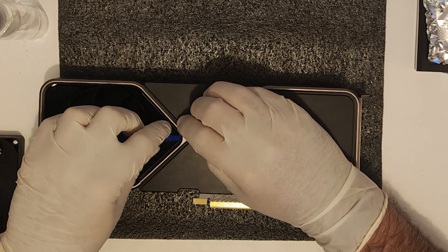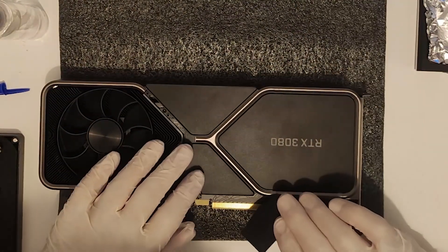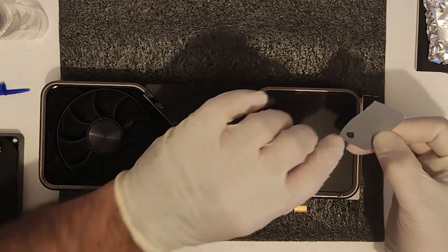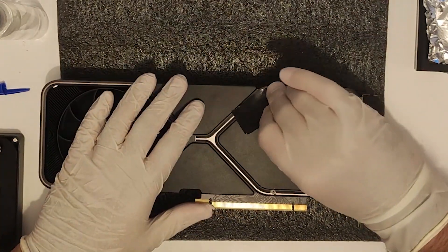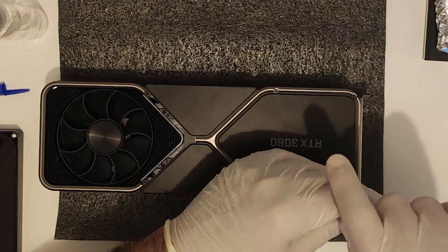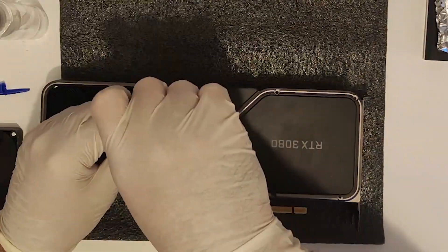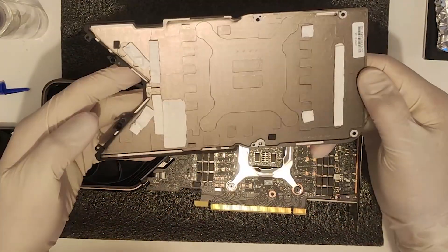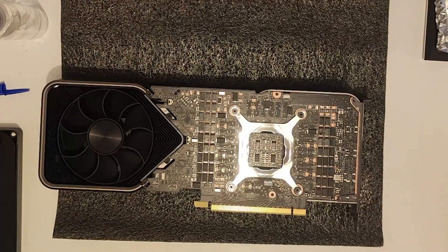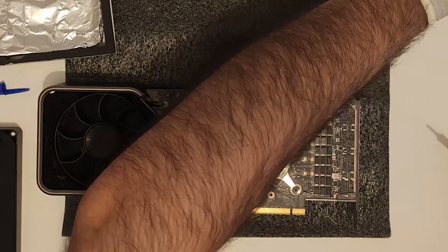First, a little Y-shaped trim piece needs to come off — it's held with magnets so it's super easy. Using strong tape, a blade, or super strong magnets, take out the four screw covers, which are also held by magnets and poke-yoked so you can't put them back in the wrong hole. Take off all eight screws and pry off the backplate. Using the card's weight is a good way to unseat it. Don't rush — you don't want a curved backplate that no longer makes proper contact. Be careful of the two very small bushings where the Y-shaped piece locates; they tend to fly off if you're not careful. At this point you can take off the IO shield as well — it only has a few screws on the front.